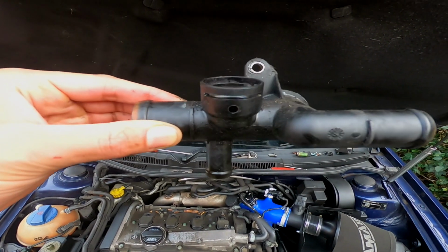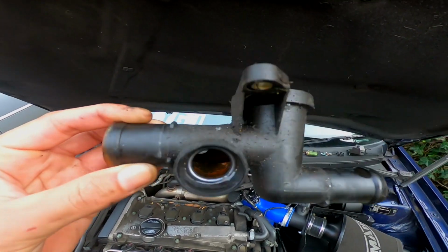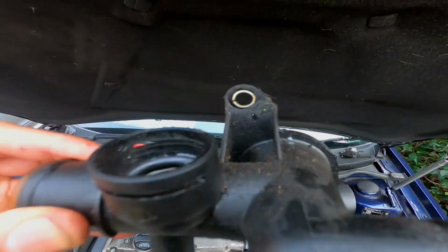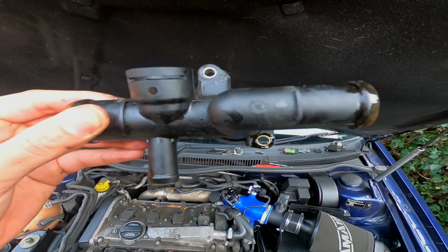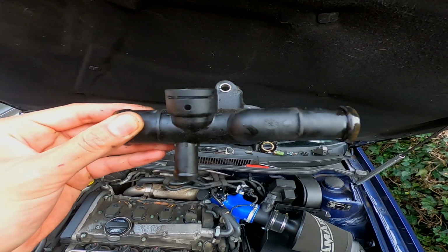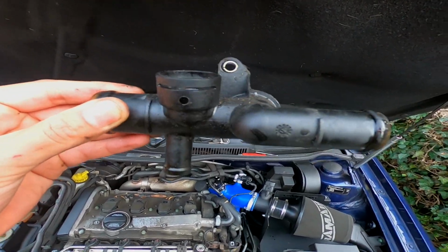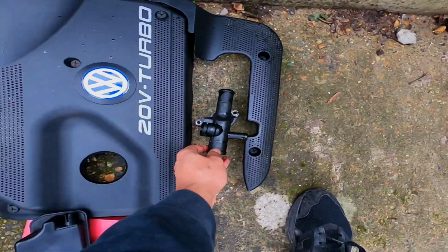All right. Okay, now here is the coolant neck. Sometimes when you look at the new part that you've bought, here's the old one, but just giving you guys a tip, you can see where the 2 Allen bolts would go now. Hopefully you can find it with your fingers anyway, but here's a tip. If you ever have a new part and you want to know where all the bits are to take off, where all the bolt holes are, you can find them on a new part and then just go to the old one and try and find it while it's on the car. So that will be going in the bin.